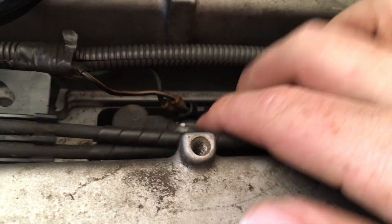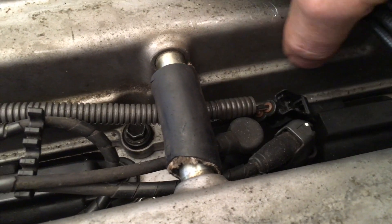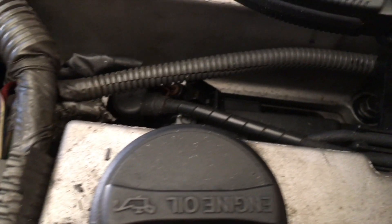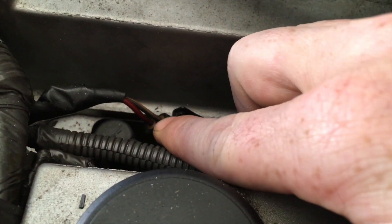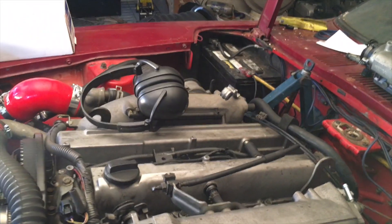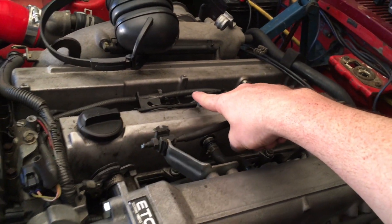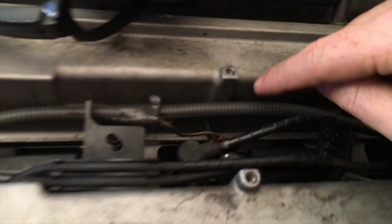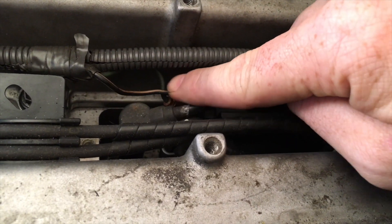What you have to do is find the common wires — like this black and white one. I got all the coils: that one's black and white, that one's black and white, that one's black and red. Use a continuity tester to find them. You hook one side of the continuity tester to the top side of it and then find it through the harness.